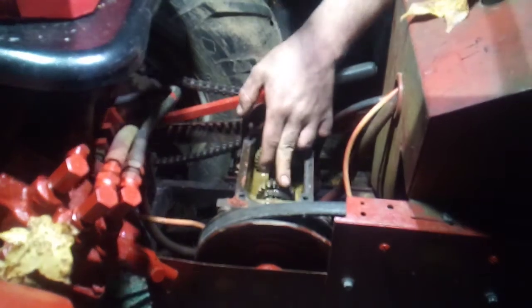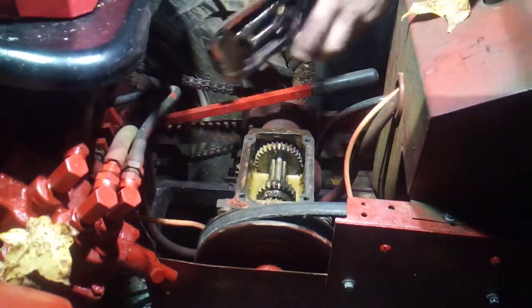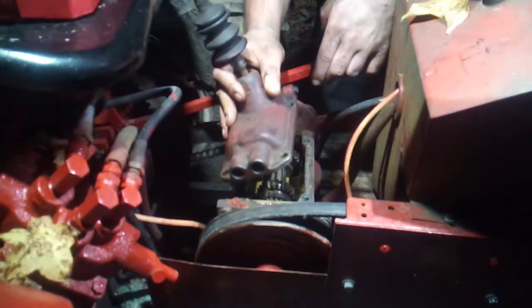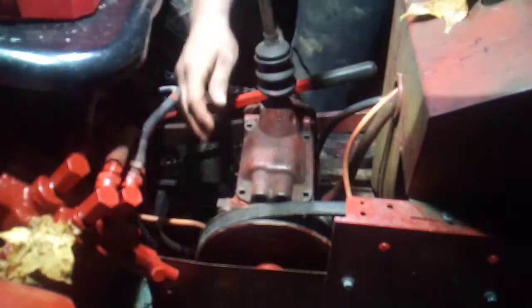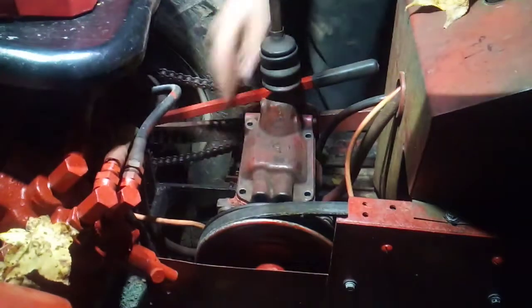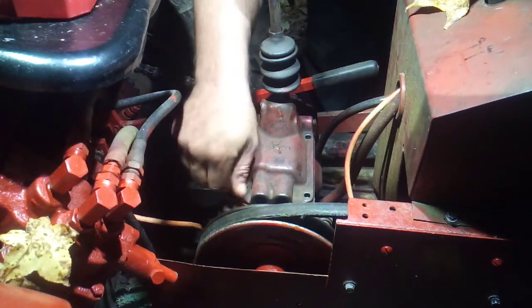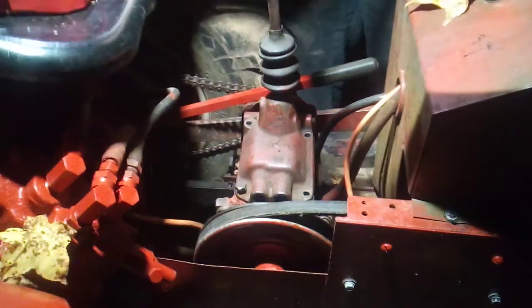If you look down here at these gears you have these grooves. Each one of these has got to sit down in those grooves, so you want to watch it and get it in the right spot. Before you bolt it down you want to check it and make sure it's in neutral, because I have knocked them out of place. You want to make sure to hand-start all your bolts before you put them on with an impact, or you'll strip it — I've done that multiple times myself.